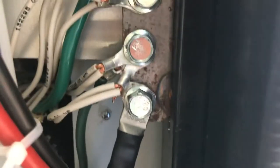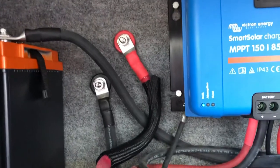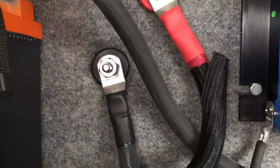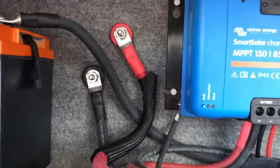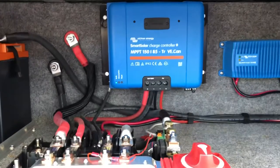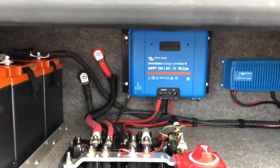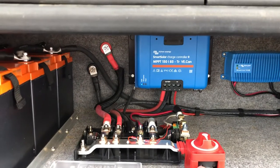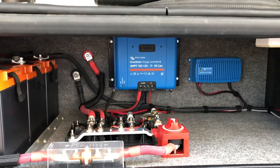Off the back here is the main ground for the entire system. The charge controller has a ground wire on the side, and the other main ground cable goes to the back and around into this compartment to the ground bus bar for the coach. Additionally, the main feed on the back wall also grounds up to the front of the coach and to the chassis. Plenty of safety grounds to make sure this system works appropriately. Can't wait to do phase two — maybe next year.